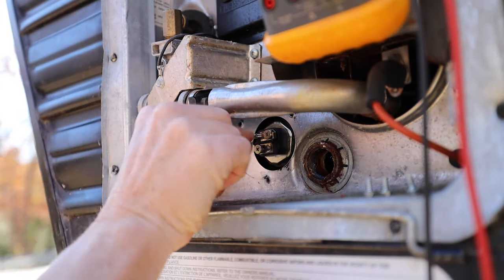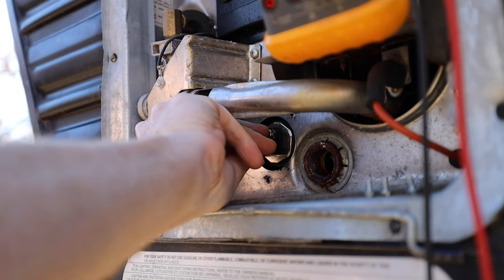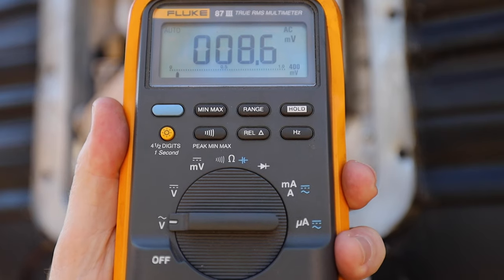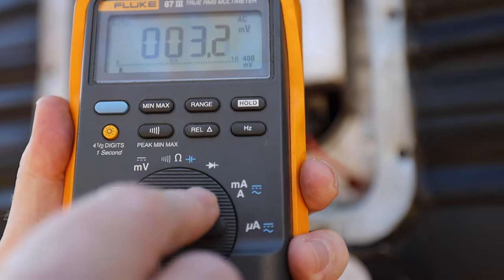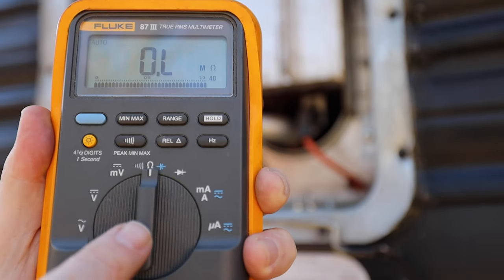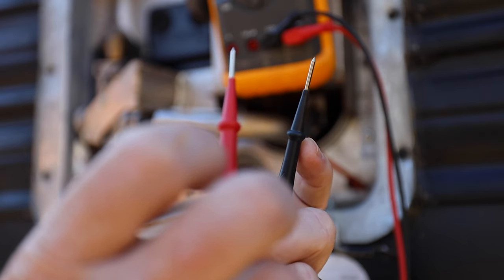Once you know you're safe, go ahead and turn these screws to remove the wires. It's important to disconnect them because if you don't, you could potentially get resistance from the main system itself — we don't want that. We want to see the resistance on the actual heating element by itself. Once the wires are off, go back to your multimeter and look for the little horseshoe symbol, which represents ohms. Switch it to that setting to check resistance.